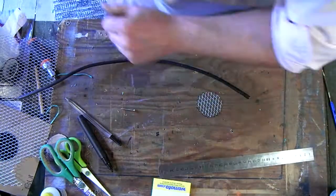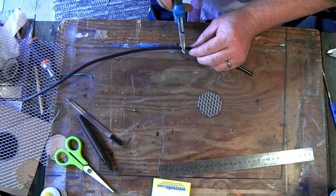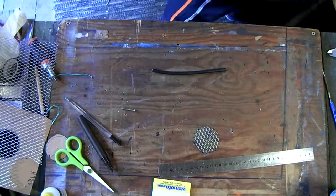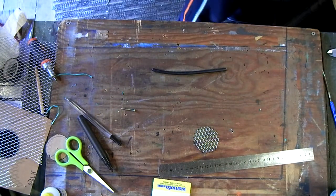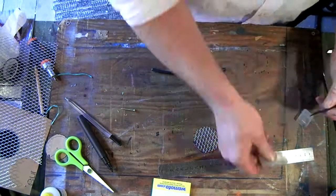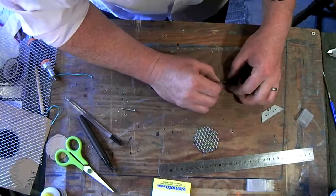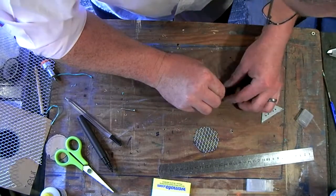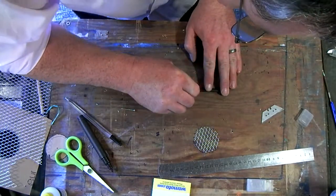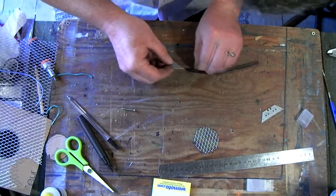This will just give me a bit of peace of mind that there's nothing massive going into the engine, into the airbox. Really big bits. I mean, it's not got any mesh on it from the factory. Triumph haven't put any mesh on it. But there is quite a lot of tubing between the fairing and the actual airbox before it gets to where I'm putting these covers over. That can go on the inside, that's a bit messy, that bit.